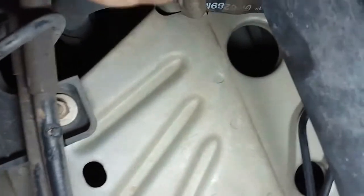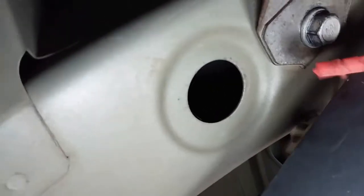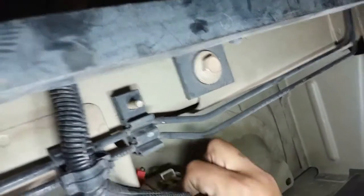Now we have to tie down this filler neck and go ahead and secure that with a flat head. For now, go ahead and connect this other pigtail — pass it from underneath or above this railing, push it through, slap it in here, secure that, and connect your pigtail right in here.